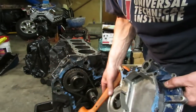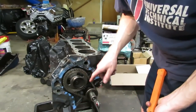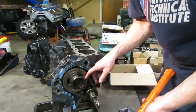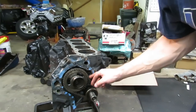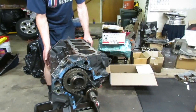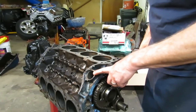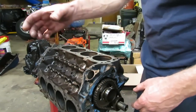Wow, this cover looks really good — and that's a Felpro gasket. This has been cleaned up and definitely been into, and it's got a brand new timing chain on it. I've got to talk to Charlie; I think he probably did this. That is definitely not original and it's got very low mileage. If this were original the timing chain would be so sloppy you wouldn't believe it — and would probably have a plastic gear. We can probably reuse that timing chain.